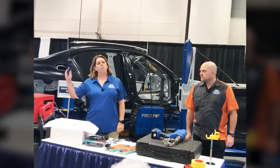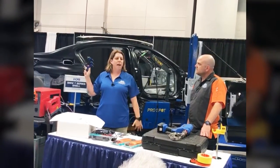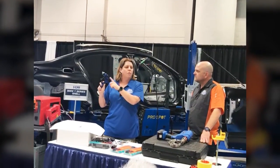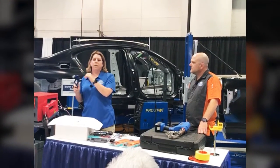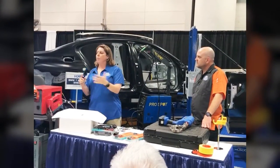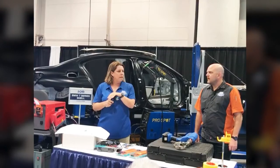But we rolled out something really crazy cool this year. It's the 1500 Solv Gun. So it's a great gun, price point $595 to get into a SATA gun. Comes with the RP and the HVLP, and it is designed for your low VOC base coat solvent. So national rule, low VOC solvent. Got a great wide spray pattern. So when I say that, it's not just the height of my fan size, but it's the width of my fan size. So if you're spraying a low VOC national compliance solvent, you know that wetting out that panel is real important. And this gun's been designed for that.